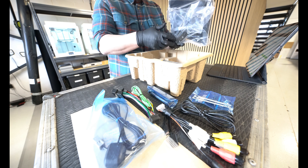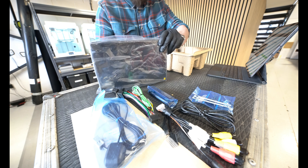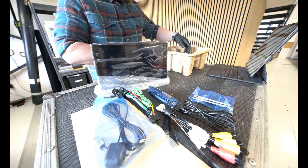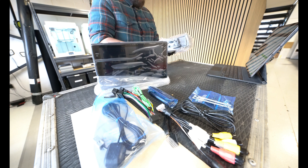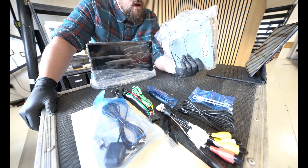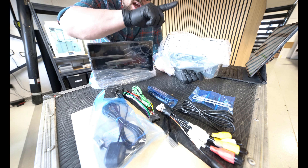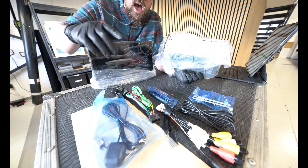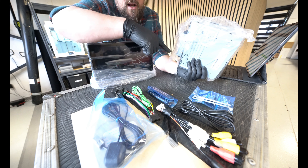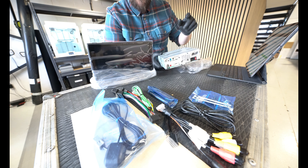Now a big screen — it's quite a fatty, that one. And then the main brain body of the unit, which is a standard DIN size. So this will go in cars that have single-DIN radios from stock — older cars, things like that. Or it'll go in a double-DIN fascia, like a Mk5 Golf, Caddy, T6 or similar — you'd get a double-DIN fascia with a pocket and put the pocket behind or below the screen. The back will be relatively clean because a lot of the connections have been handed off to fly leads.